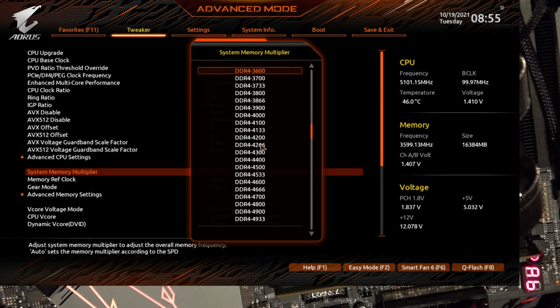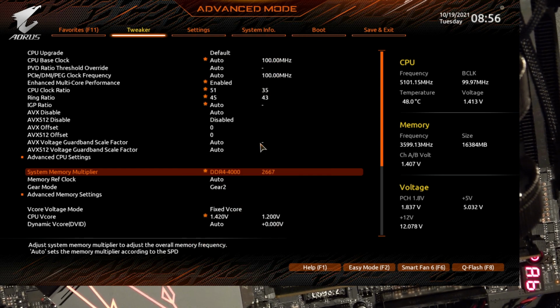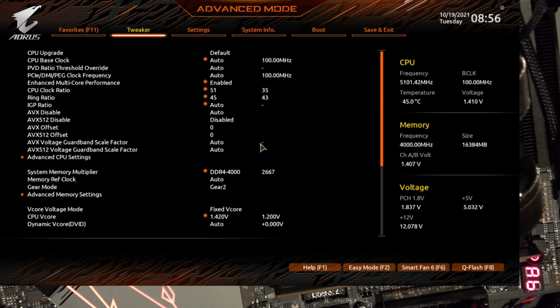Well, I do remember one thing. This stuff tolerates a lot more voltage than Samsung C-Die does. So yeah, that is one thing. If you had Samsung C-Die based sticks, you wouldn't actually want to shove 1.4 volts into them. That would be a terrible idea. But this isn't C-Die, so we don't have to worry about that part. Yeah, so that's nice and easy.